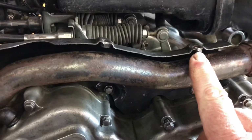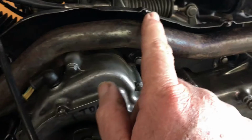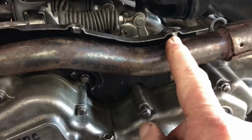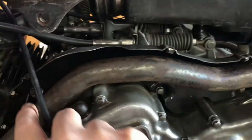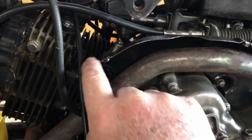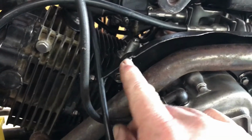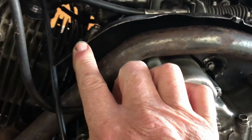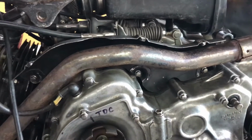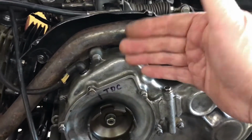These welded on nuts on the back of this thing here all had not sheared off bolts but angle ground off bolts in all 3 locations. I have cleared them by heating and using vice grips on the remains of the bolts to get those 3 bolt holes cleared. What I don't have, and you may say, well, why the hell have I bothered, is I don't have the cover that goes on the front of this.